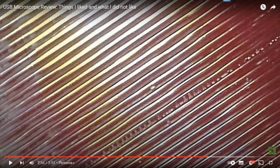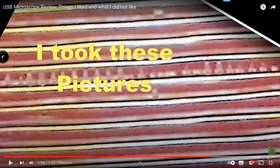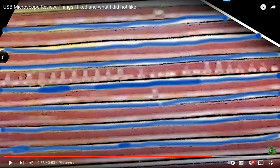With various companies vying for the market, well, we won't go into all that. Eventually they ended up with micro grooves, which are very, very thin grooves, and with the sound cutting into it. But it's a bit of a problem. The bass is quite a big movement, and the treble is very small. And if you look on here, these are grooves I actually use in my own microscope. You can see here what looks like bits of sugar in the middle. That is actually the treble, and the slight waviness that you can see is the bass.